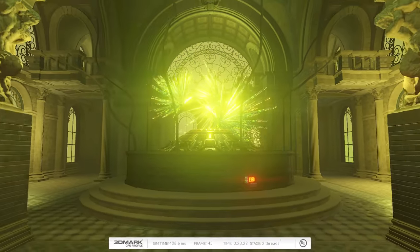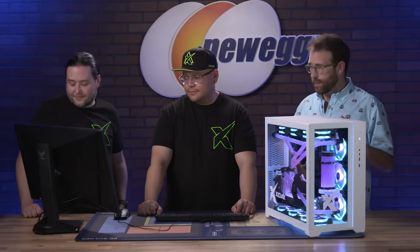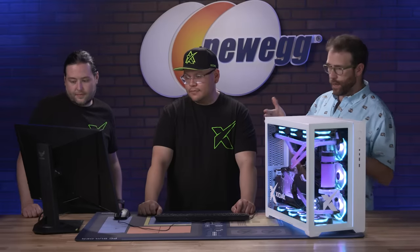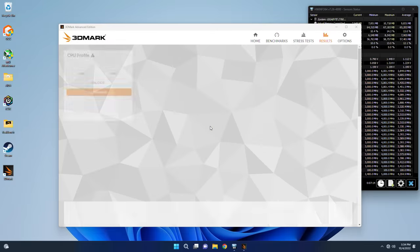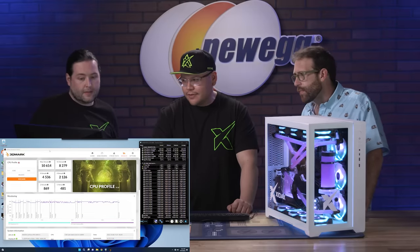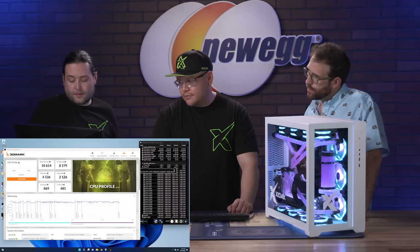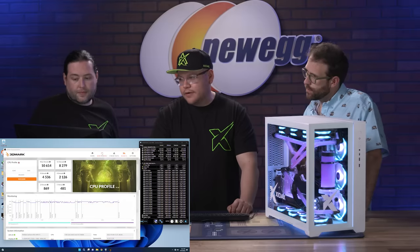Two-thread test — this is the fun part, it just walks it down from all threads. This is where we'll really start to see a huge amount of performance. This performance is purely based on overclocking the CPU. When performing at this level they are delicate — it's all about balance, and that balance has got to be meticulous. Your max thread score went down significantly because we did drop down to 5.6 on the rest of them, but your overall P-core on the two of them is higher. So do you want to try 6.1? If we're doing that we might as well go 6.2.